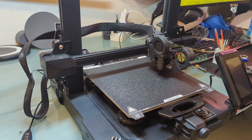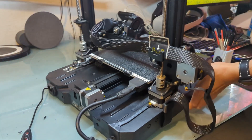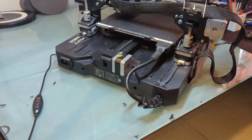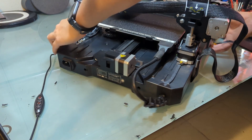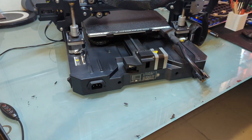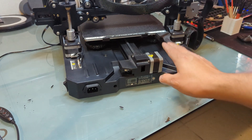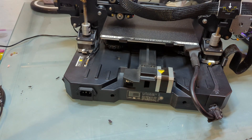I really just want to show you guys, because I'm trying to install this mod for the cable in this case — for the bed cable. In these machines specifically for the S1 Pros, I'm not sure if the S1s have the same issue, but basically what's happening is that the cable is just getting snagged on either the stepper motor itself, which would be this one right here, or along here through this plastic.